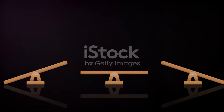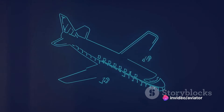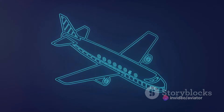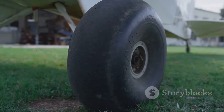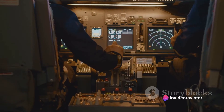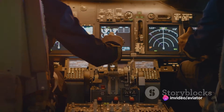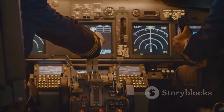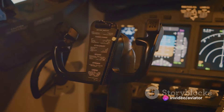What does longitudinal balance mean? Imagine a teeter-totter. If one side is heavier, it tilts down. The same concept applies to an airplane — the aircraft must balance around its center of gravity to maintain stable flight. The horizontal stabilizer exerts an upward or downward force at a distance from the center of gravity, ensuring that the summation of pitch moments around the center of gravity remains zero. In simpler terms, it keeps the nose of the plane from pointing too far up or too far down.